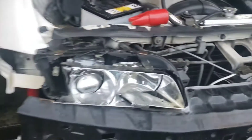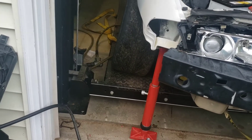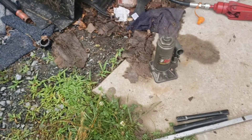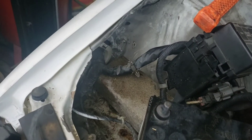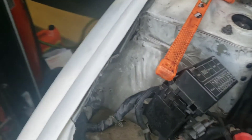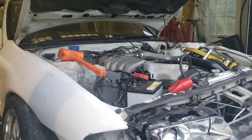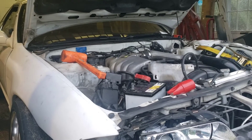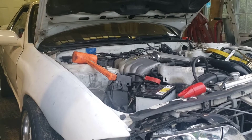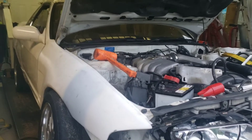So we've been using the frame puller on the right fender support. We have the frame puller underneath holding pressure right now, and we've been using a bottle jack — this bottle jack right here — inside the fender well where the battery and antifreeze overflow tank sit. We've been using a brick to press against, pushing up on the fender support, and you can see the fender support is now lined up with the fender. The fender itself isn't bolted on but it's sitting nice and straight. I'm going to take the fender back off and see how the fender support stays on its own. If it's in a great position, we can bolt up the fender support braces and then put this fender on the car permanently.